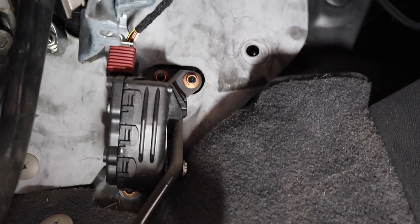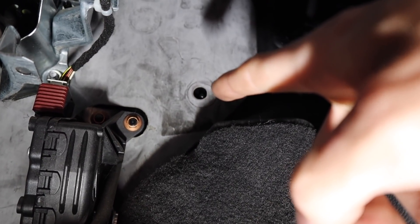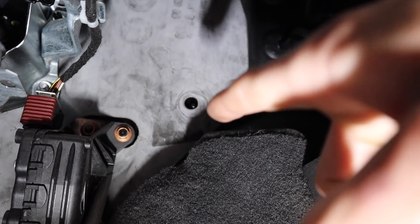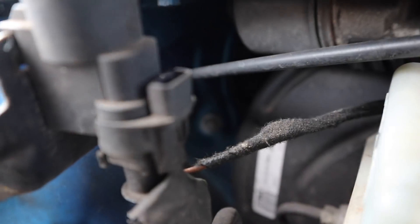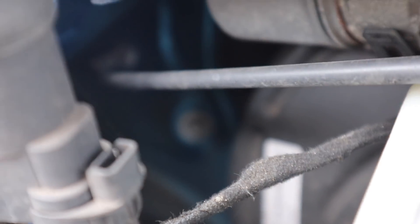What I've done is removed the cap from that nut there. So there's the pedal — we'll just remove that. I've got to go into the engine bay and find the actual nut, get it out, and then I'll be able to put the boost pipe through that hole. In the engine bay, it's literally this silver bolt right here, right next to your brake servo. All we do is get an extension, take that bolt out, and then we'll run the boost pipe from there so we don't have to run it all around the engine bay.